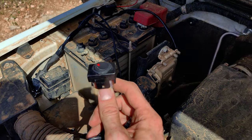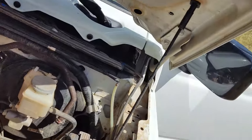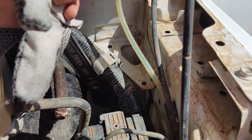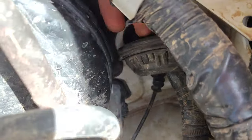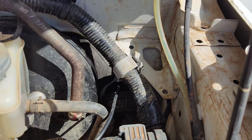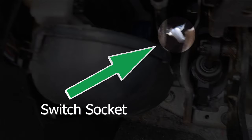And now the trickiest part — how to move the switch from the engine bay to the driver's compartment. Turns out there is a hole in the car's firewall which is sealed by a grommet. Unseal the grommet and feed the cable through the exposed hole. We will find the cable behind the pedals. And here is our switch socket — grab it and pull inside.